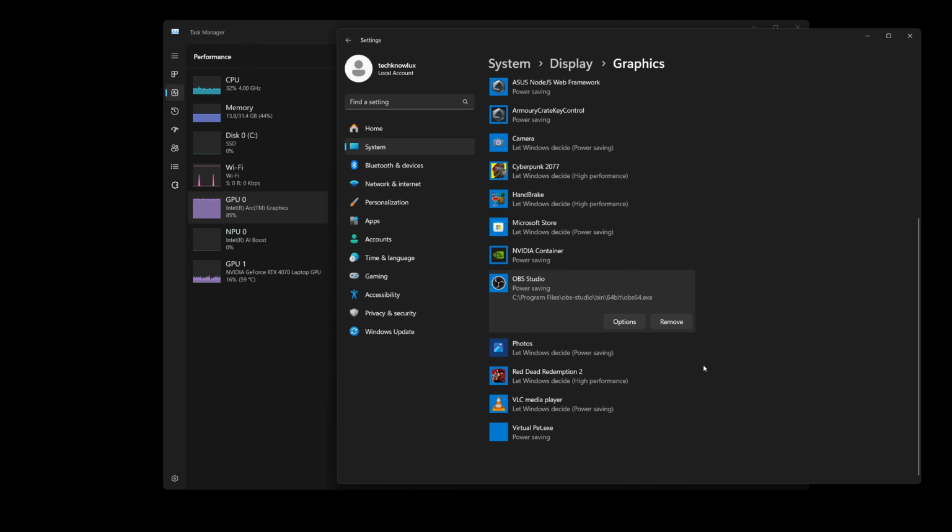Now, what we'll do here is we'll quit OBS. I have it running right now to do this recording. We'll quit OBS. I'll start it back up. I'll show you what the difference is in the CPU and the GPU usage, and then we'll talk about some gameplay and do a short video demo to demonstrate that it doesn't exhibit those thermal throttling effects that I was seeing, where power levels would drop down because of very high GPU utilization, and you would get from 80 or 90 watts or so roughly on the 4070 in this Zephyrus G16 for 2024, kick all the way down to 40 to 45 watts, and the game would become unplayable. The driver would crash depending on what game you're running in. I tested with Dragon Age the Veilguard and also with Star Wars Outlaws. So let's come back here with this setting applied, and we'll talk to you more in a moment.